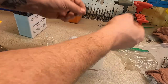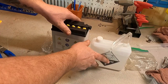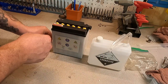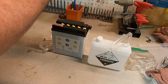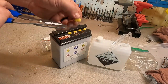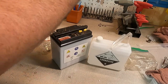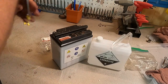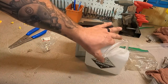Now you will get some of these that have the same number of ports as the battery. You can just peel the cap off, flip it over, dump it all in there. This one's not quite that simple. So we will pull this sticker off and take a pair of pliers and pull each one of these little plungers out. These just press in there — there's no threads or anything on these ones. We're going to set these off to the side. You could do it one at a time — I'm just going to do it like this.